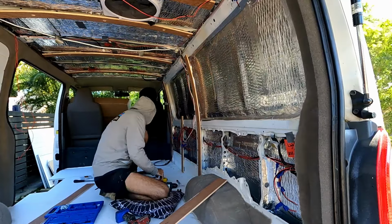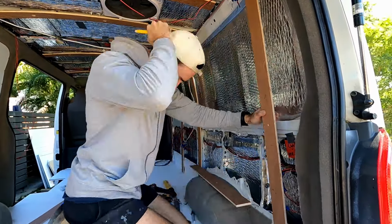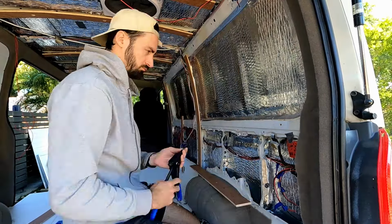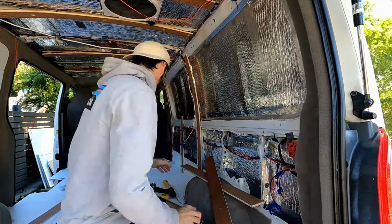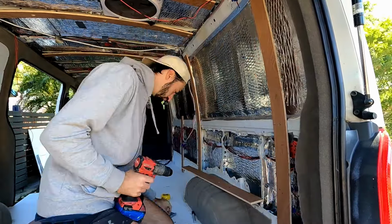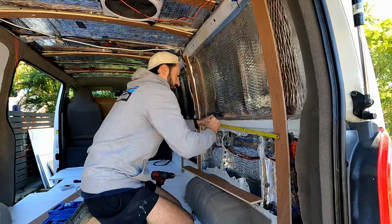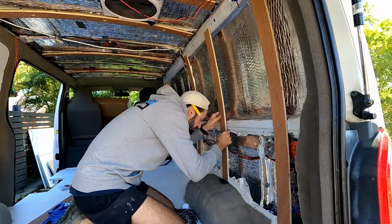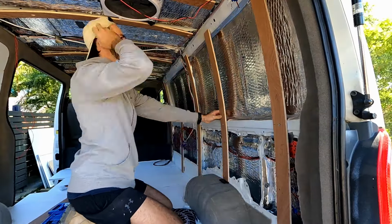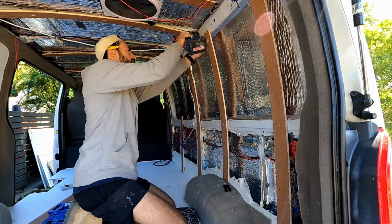If you're using a nut riveter like you see me using here in this video, first you'll need to do a dry run. So sit your strip on the 20mm of packers on the floor, or so that your strip at least reaches the top metal beam in your van. Then push the timber into the position that it will finally rest in against the middle support. Now use a drill bit to drill a pilot hole through the timber and the metal support behind it. So you can use that pilot hole to place your riv nut in the metal support, and it will align perfectly with the pilot hole you have in your timber strip. From there, you just glue your strip, bolt the middle, and screw the top and bottom of your supports.